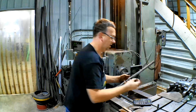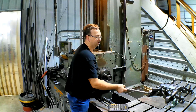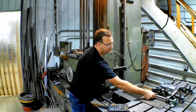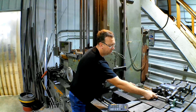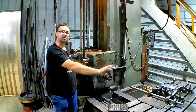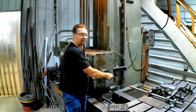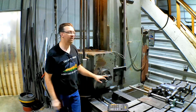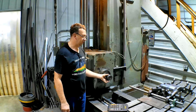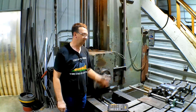We'll do the same thing on the second spot. With our cutters all in, it goes into the bores. We'll slide it through and into the bearing. Then I'm going to drive it with the spindle — I've got two feet of spindle travel. We'll run the spindle out to it and put it in the collet. This is a TG-150 collet chuck. Then we'll clamp her down and drive it rotationally with feed to make our cut.